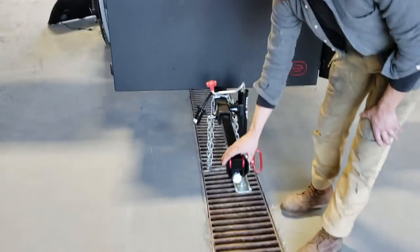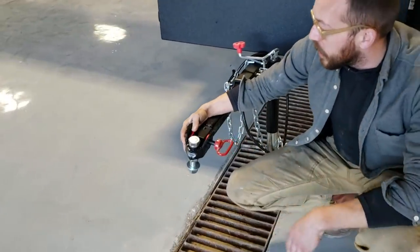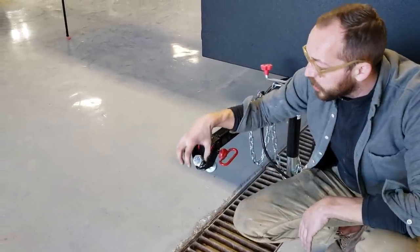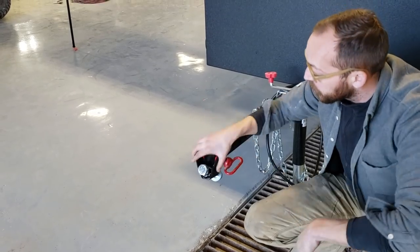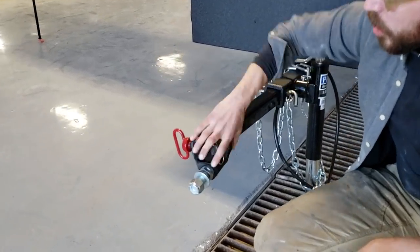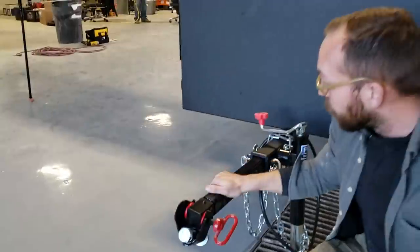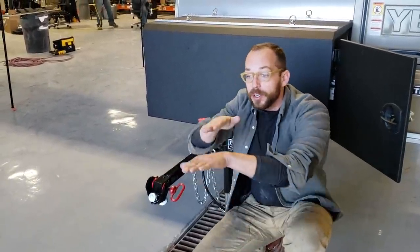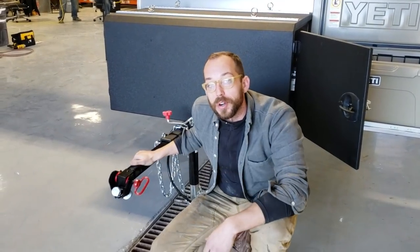The other thing you see here is the max coupler. This is an optional hitch accessory that gives you a little bit more free range of motion. A traditional ball coupler is just a two-inch ball with a coupler on top, but this one has full range of motion up and down all the way around, and when it mounts to the vehicle you'll have swivel motion there. Really nice if you plan to take it on more technical roads where your trailer will be a little off-camber or the approach and descent angles are more severe.